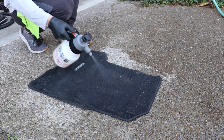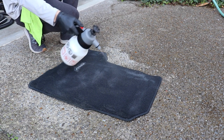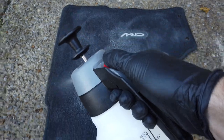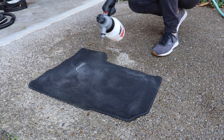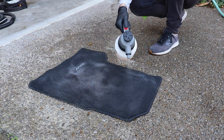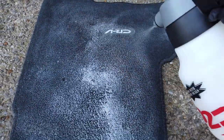Step number two: I am pumping up my pressurized sprayer. I just have a degreaser diluted somewhere like five to one. You can use your favorite cleaner, all-purpose cleaner, degreaser, whatever you want, and I'm just spraying the mat and I am going to soak it. I'm being super liberal with the product — please use a lot of it. The idea is to make a mess. Some of you are thinking it's gonna turn into mud — yes, that's true. That's actually part of what's going to happen here, because it's not going to vacuum out unless you take extreme measures.